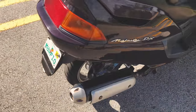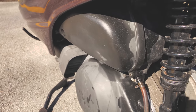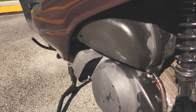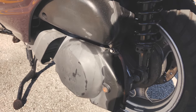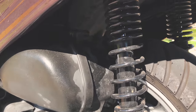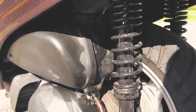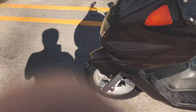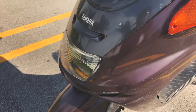The previous owner actually rode the bike without a proper air filter, so I just bought one and put it in. For this type of air filter you have to soak it in oil, so as you can see the oil is dripping down from the filter — that's normal, I probably put a little too much oil and just need to wipe it down. The rear suspension appears to be in good working order, not much rust — maybe just regular edge rust, but it has aged quite well.